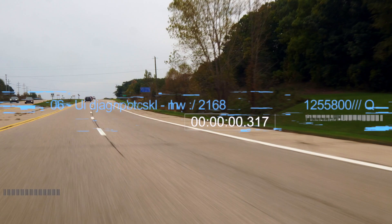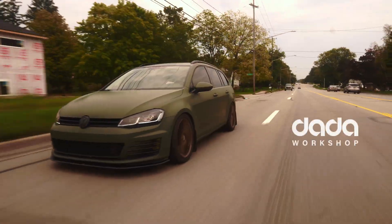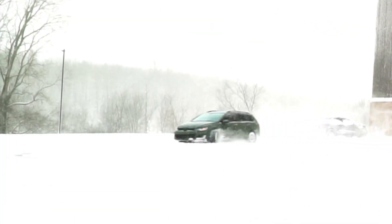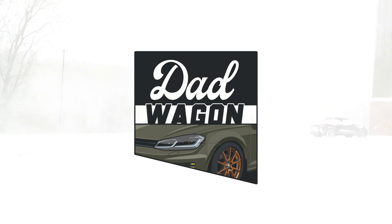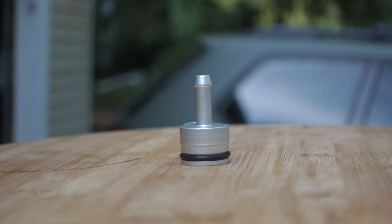In this video, I'm going to be removing a coolant flange that's prone to break on the EA888 engines and replacing it with one that's made out of milled aluminum. Today I'm going to be installing a super simple and easy little part that goes in your engine — it's really just a preventative maintenance piece. Your coolant flange that feeds your turbo is known to fail. It's made out of plastic, and the one we're going to be replacing it with is made out of aluminum.